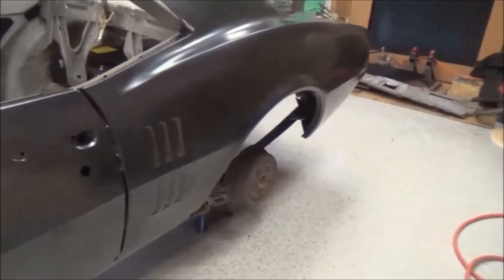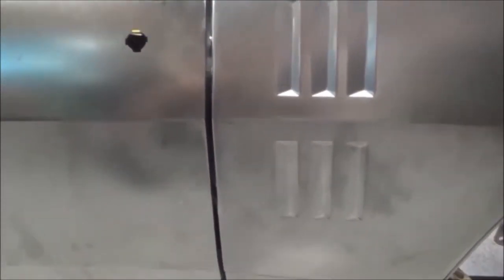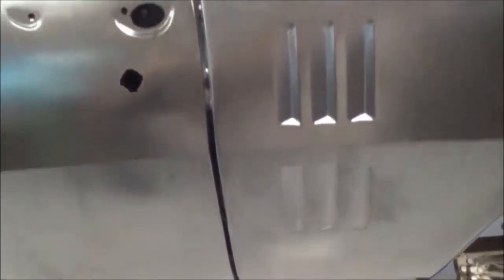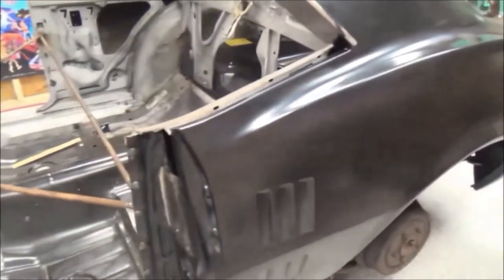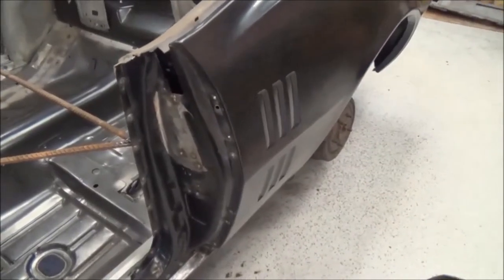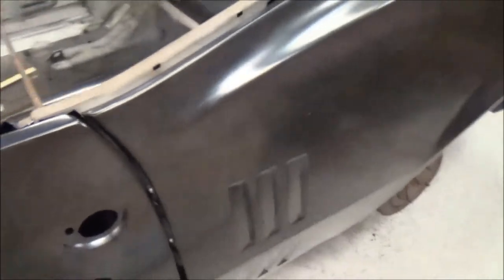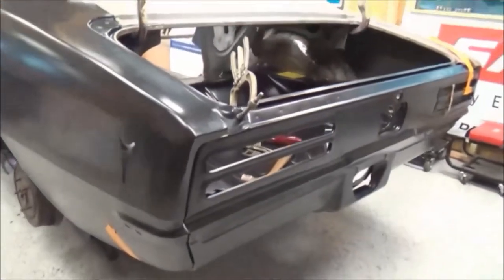After a few days of fitting, last night I welded the quarter panel on the car. The body line seems to match up pretty good. I've got a nice big gap on the door, which was what we were looking for — because once I'm done doing body work on the door jam to cover up those welds and painting everything, it will probably be down to the 3/16ths door gap that we're looking for. Things are lining up pretty good. Getting ready to mount the other side of the car.